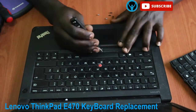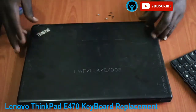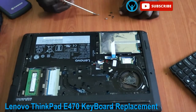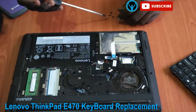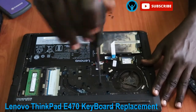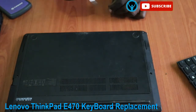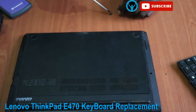Slide it slightly inside. Once that is done, press a little harder, then pull each side back — this side, this side, this side, this side. Then cover it and flip it over. Remove the cover again and return the two screws that hold the keyboard: screw number one and screw number two. Then put back the cover and the bottom screws gently.